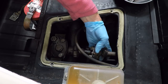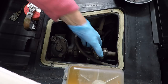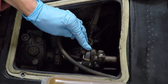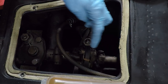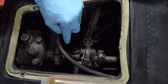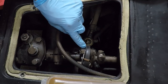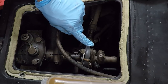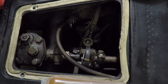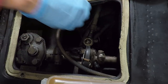So this is about the amount of play that's in the steering — from there to there — and it really shouldn't have any play at all, which is kind of a bummer. While you're in here, you definitely want to check the condition of this rubber coupling, because this is the steering shaft from the steering wheel itself connecting to the steering box. If this goes, you will not have any steering at all, and these things have been known to rip and tear apart after 40 years. It's good to see this one's been replaced at some point and looks pretty solid. The tie rod ends all have lots of grease around them, which is good — they've been serviced lately.